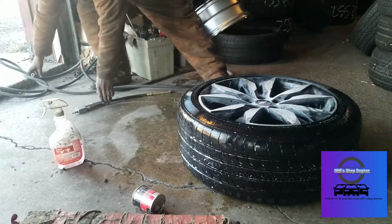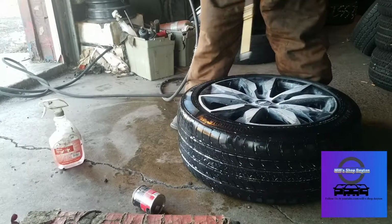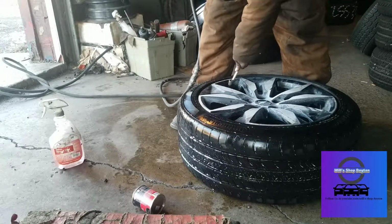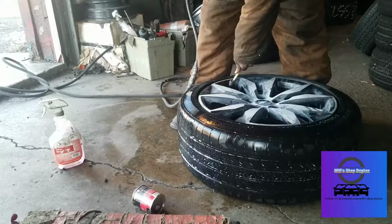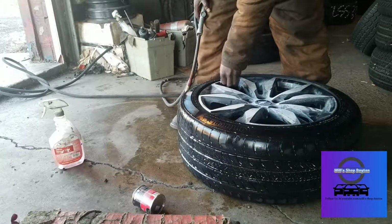Common problem, you pick up nails any and everywhere at any given time. So if your tire is leaking every couple days, once a week, definitely take it off, spray it with some soap and water, find out where your leak's coming from. This is the tire plug video.